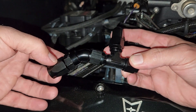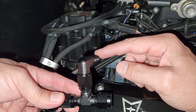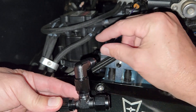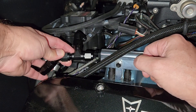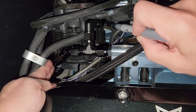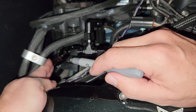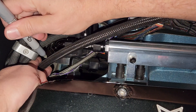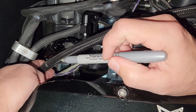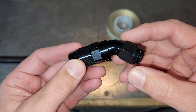Here's what I'm thinking: a 45 for our fuel line, then a T, and this will go right on the end of the fuel rail. Then we'll have this come up and point it down a little so we can put the sending unit on here — it's like three or four inches long. There we go. Got the T, got our 90-degree for our gauge, and a 45 over here — that's the fitting for the hose. With AN hoses, put all your fittings where they're going to go, then measure your hose. I'm taking a gray Sharpie — it'll make sense in a minute.